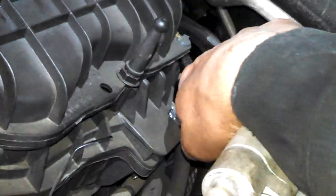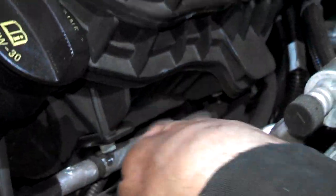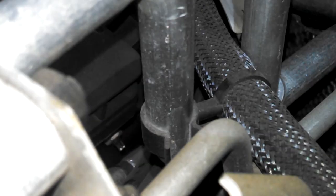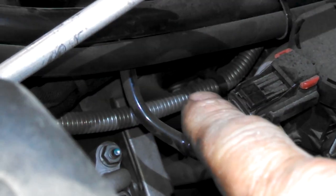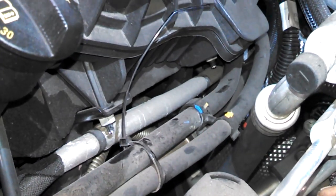So we're on the driver's side, and the trickiest part might be this piece out here, but it's already broken. We got two brackets over here, a metal bracket back there and here, a 10 millimeter nut. And also down there is maybe a 13 millimeter, and I'm sure on the back side, which you can't even see, is the same. You're just gonna have to go by feel down there. That's gonna be the toughest part here.